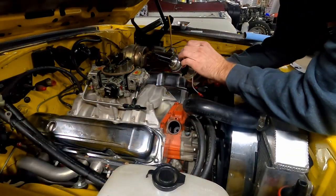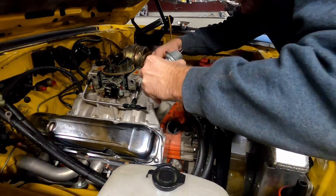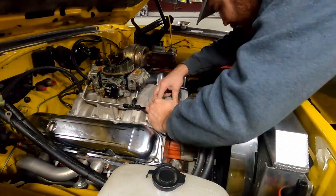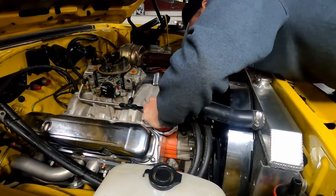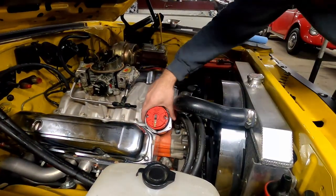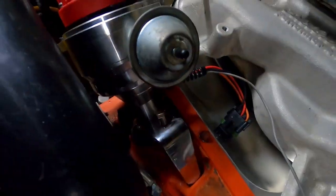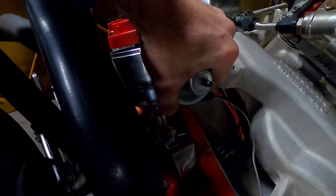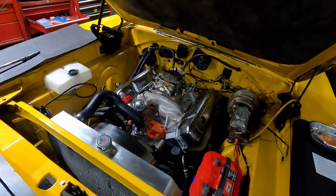Got aluminum dust everywhere - cleaned it up as best I could with the vacuum. Got a little clearance there on the head now, so hopefully the distributor will slide right in. Let's get that towel out of the way and see if we can get this in the right spot. Put our little gasket down in there. I think we're going to be in business - it just went right down where it's supposed to go. It's definitely still tight but it does fit. The distributor is in and now I can adjust the timing back and forth, which I couldn't do before because it was jammed up against the cylinder head. One problem averted.